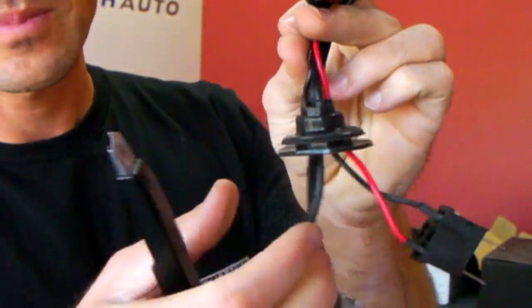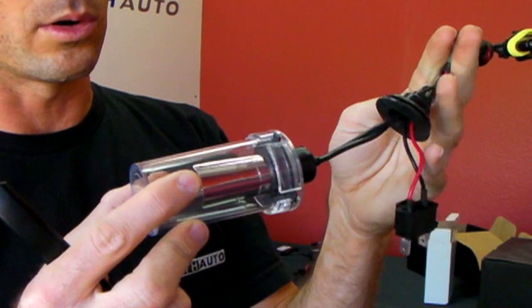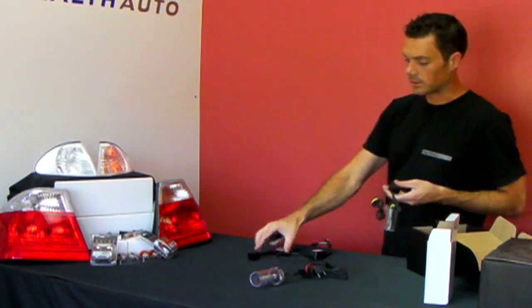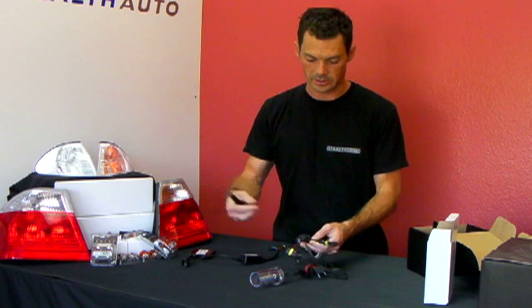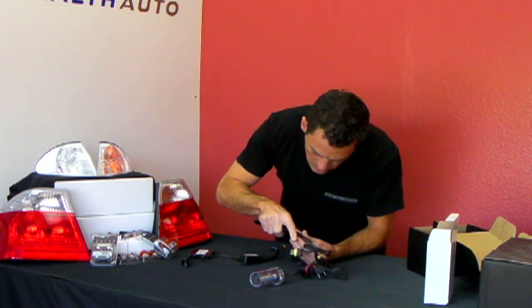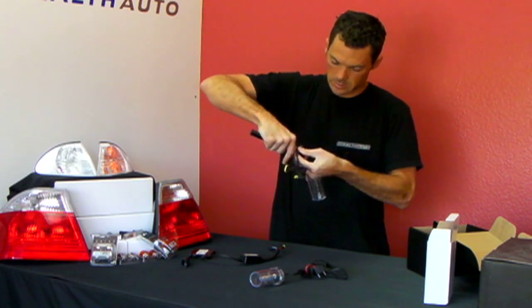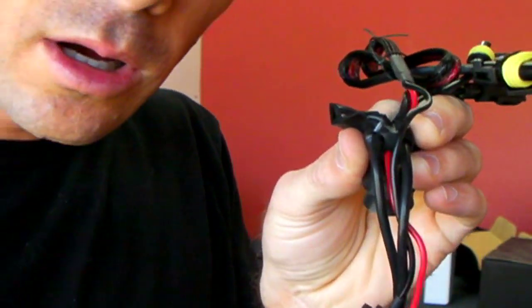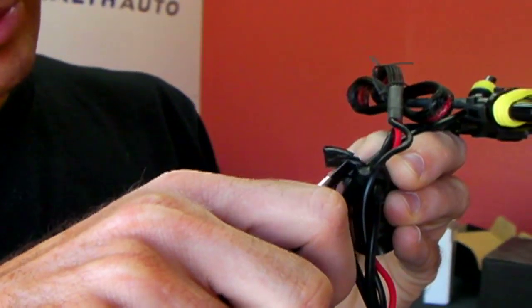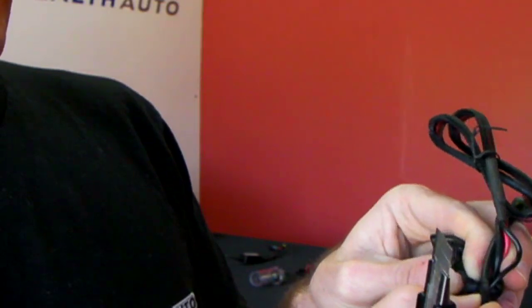I'll just give you a closer look. This grommet can be cut — it's not going to be used because the seal is actually done in the headlight where the headlight connects to the bulb. I'm just going to cut this off to show you how easy it is. What you want to watch out for is that you do not cut any of the wires. I'll usually just use a little X-Acto blade to make a tiny cut. Once you get a cut started, if you put just a tiny amount of pressure on the plastic with this blade as you're spreading it apart, it'll pop right open. And it will keep you from cutting the wire that you don't want to cut. So, that one is out.